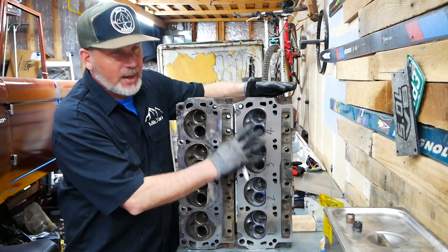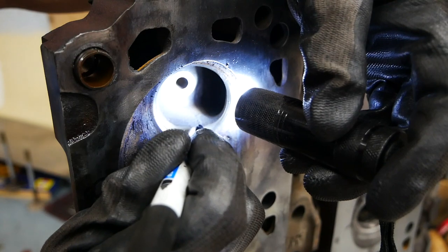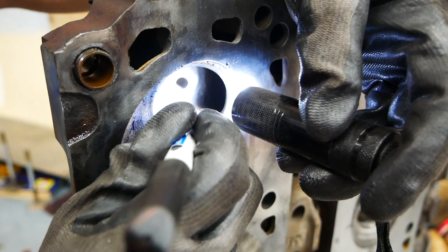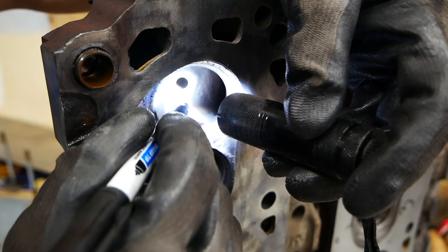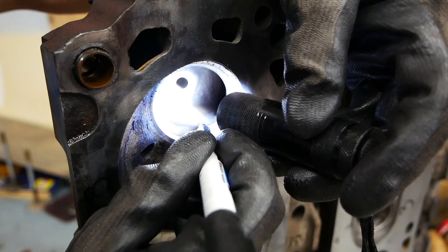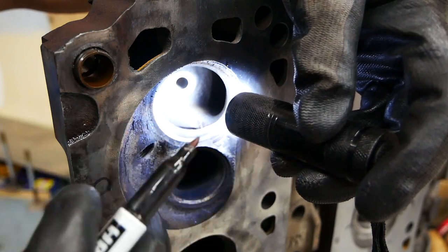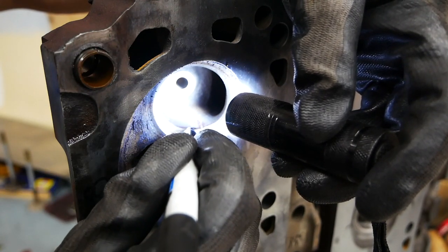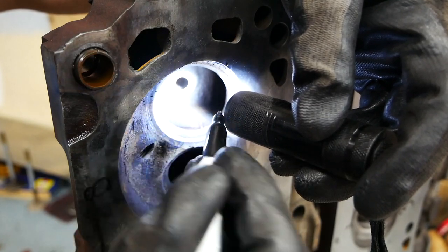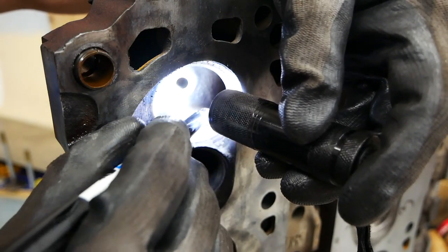So now I've got the squish flat and the combustion chamber modified — I'm going to leave it just the way it is. Now let's get into the intake. On the intake there is a casting vein in there that I'm going to take out with a burr and make completely flat. There's also a back-cut ledge from valve cutting that runs all the way around the throat — I want to level that out because the step creates a ledge, especially a big one on the short radius, and I want that nice and smooth going around.